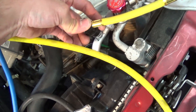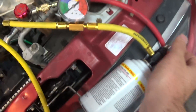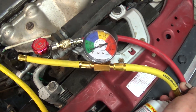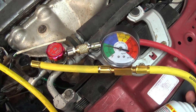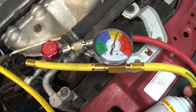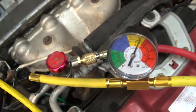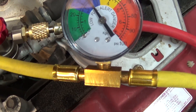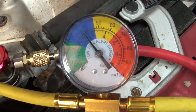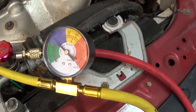You can't put it on the high side because the high side port is just way bigger. You can see it's reading zero — I'm going to go ahead and open it up. You can see the pressure is raising right now. I'm going to go ahead and start the car and put the AC on full blast so it starts cycling. With it running, it's dropped down to about 35 PSI. You can see the clutch is engaged just down there, so I'm going to let it charge up a little bit more.